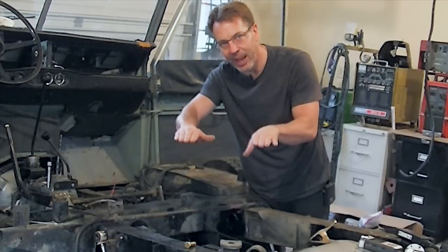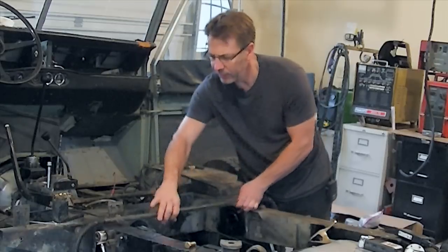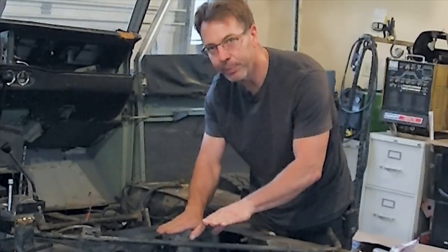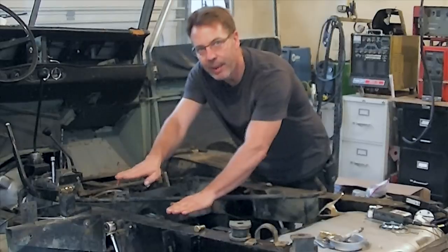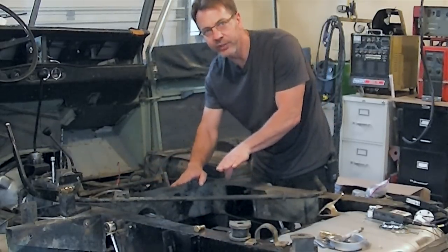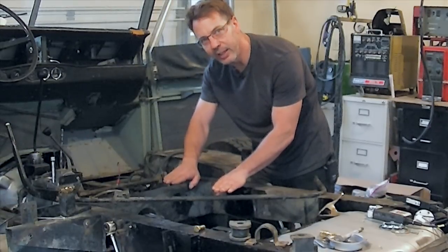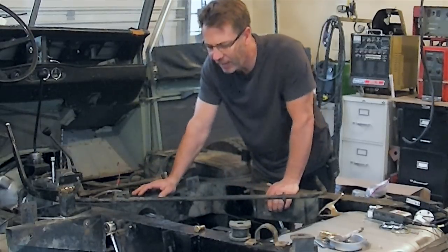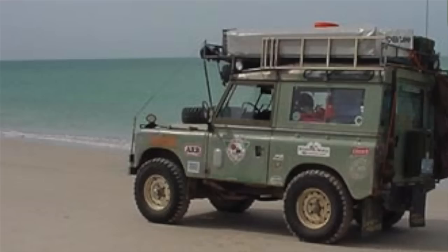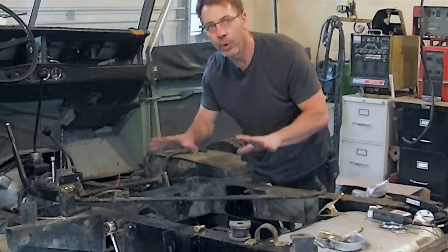What it allows is if one side of the axle pushes up, the other one brings it up too to match it out. So if we're going across a speed bump at an angle, this one hits, but this one gets pressed down, levels out, and brings it back to level. When you're going around a corner, there's more pressure on the outside wheel, so it brings pressure on the inside wheel and helps level the vehicle. It's incredibly important, especially on a Land Rover, if you like to put a lot of stuff on your roof rack and make it top heavy — a sway bar will help correct that.